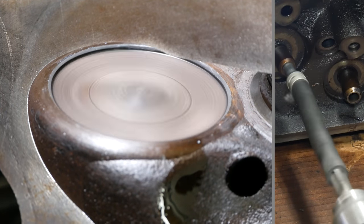Once it seems like everything is dry, we'll spray the head down with WD-40. After it has been thoroughly coated, we'll go back over all of the machine surfaces with a shop towel, trying to make sure there is no surface rust forming or other debris left on them. It's also a good time to do at least a visual examination for cracks anywhere in the casting. Then we'll get back to the other cylinder head and make sure it receives the same treatment: a thorough scrub down, then rinse, blow dry, and a protective coat of WD-40. The machine surfaces get a quick wipe down, and then we're ready to get these back on the bench for reassembly.